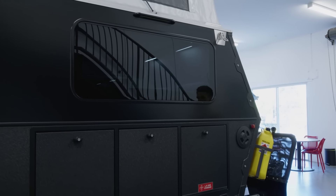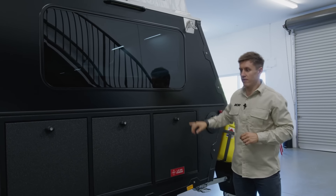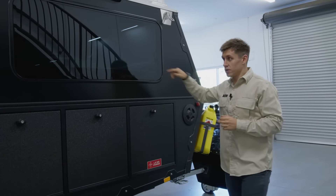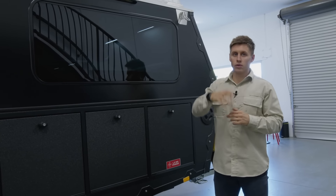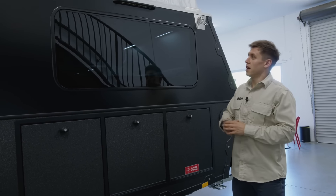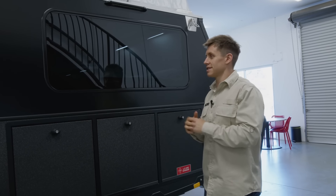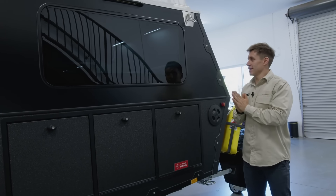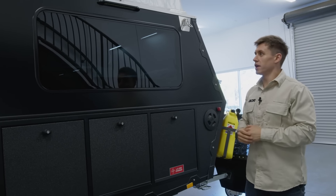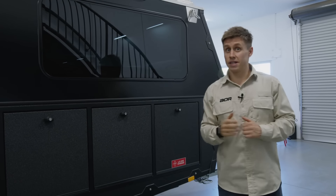The slimline tinted windows will marry in with all the black trim incorporated across the bottom and across the door frames. The real benefits are: A, they're tinted — so we're going to get heat reduction inside the trailer, but also a privacy aspect. When you're laid in bed you get good views out, but people can't really see in too well, giving people a more comfortable feeling. Inside, there's no change — you'll still have your pull-up blind and pull-down midgey screen. One benefit a lot of people don't realise is that because they are slimline — reduced by around 10mm in protrusion compared to the previous model — there's a lot less chance of these getting scratched when taking the trailer through scrub.